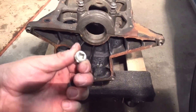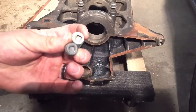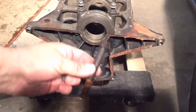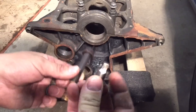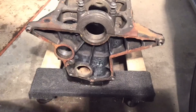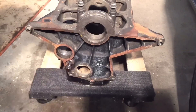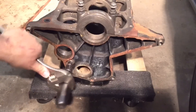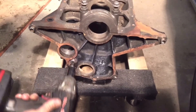The square drive on the oil galley plug isn't just a normal three-eighths inch drive — it's a little bit smaller than that. The new ones are hex, which makes it easy, but getting these old ones out is pretty hard. The best way to do it is take a head bolt, because they're so strong, and take it to the grinder, grind it down until you've got a nice little square. These bolts don't shear off as easily as a grade 8 — they're really strong. Get it to where it fits in there pretty well, set it in, use a little impact, and just nail it to break it loose, then you can run it out pretty easily.